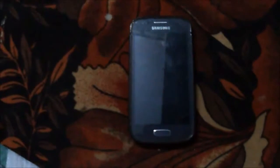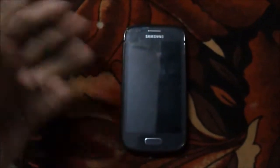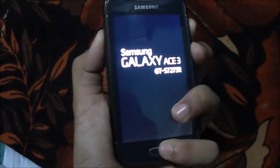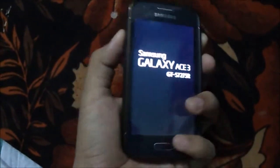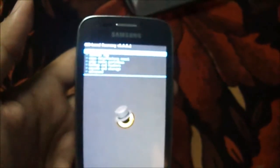You need to place your mobile into recovery by pressing the Home key, Volume Up button, and Power key at the same time. In my last videos I showed how to install recovery on your device — links are placed in the description down below. Press those keys at the same time to boot into recovery.